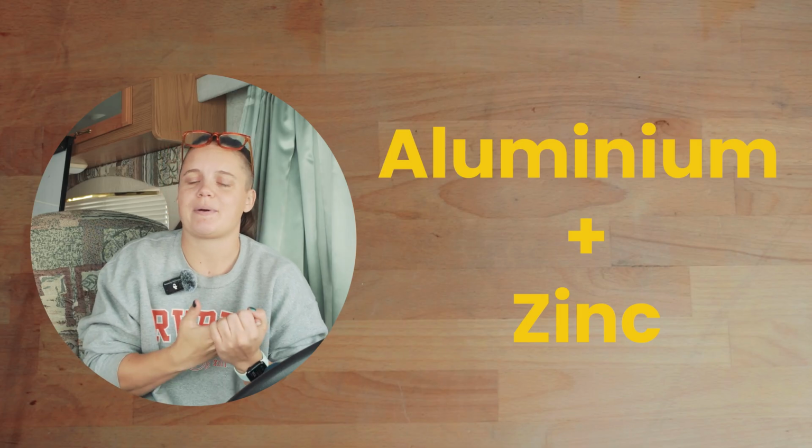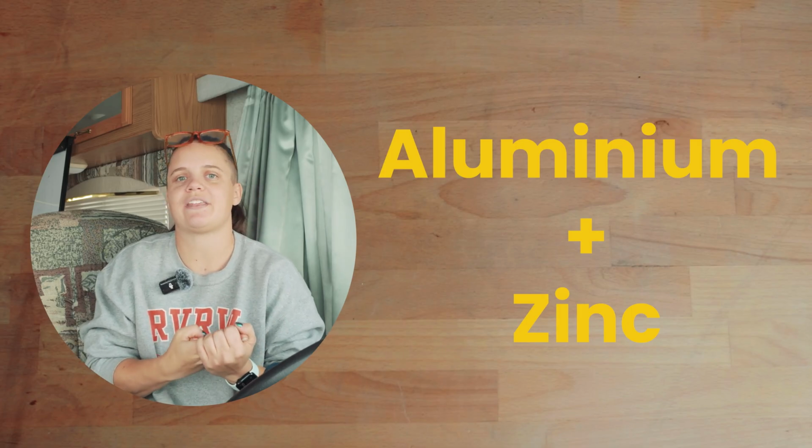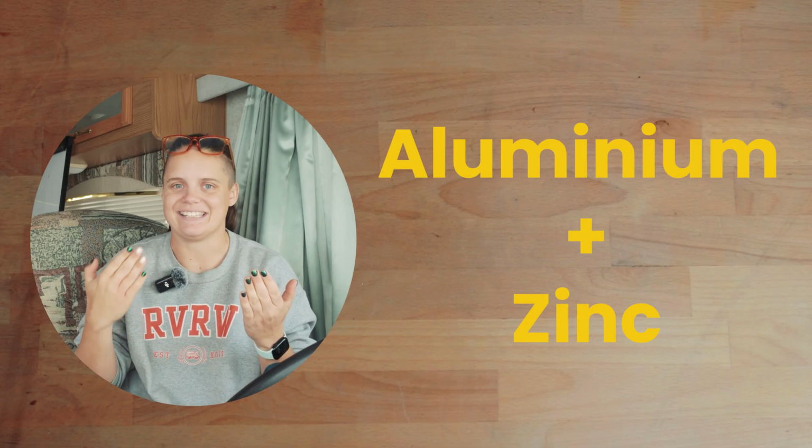The short and sweet of it is the cheapest anode rods are made of magnesium, and that magnesium can have a chemical reaction with some of the chemicals in your water, and they can mix to create a third chemical that creates that rotten egg smell. The way that you can solve this is by upgrading your anode rod to one that is made of aluminum and zinc. The aluminum and zinc anode rods will not create this third smelly chemical and will help prevent your water from smelling.